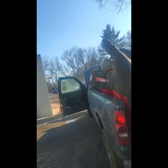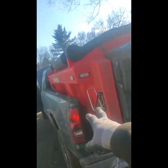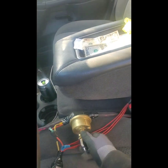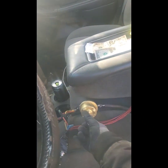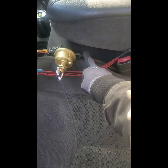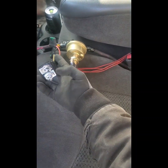I ran the vibrator on a separate wire to the switch and did the same with the strobes. You get full blast speed - you can't control it, but we needed it that day. We ended up getting another truck and that one didn't come with a controller, no wires, nothing. Before I figured out how to do this, I couldn't find anything. Just ask about the two-way switch - or two-position on/off solenoid, power solenoid - that's what it's called. If you want to run everything off one switch, hook everything up from this side with the battery cable, and hook the spreader, vibrator, and conveyor up on the other side. Otherwise you gotta run a new line for each thing separately.